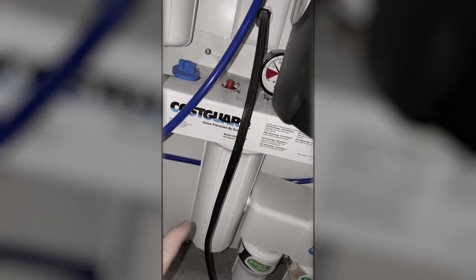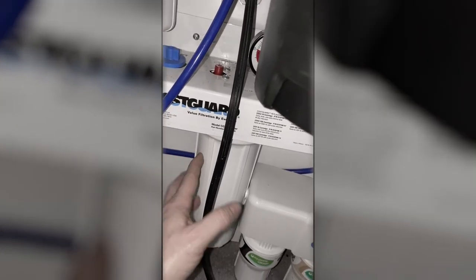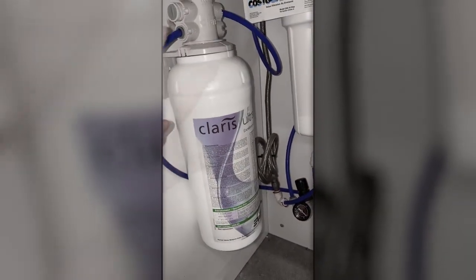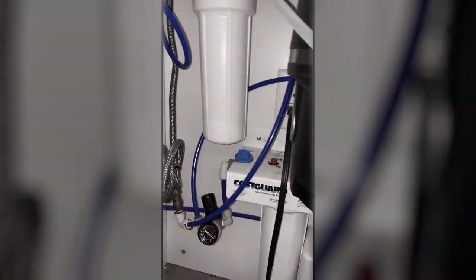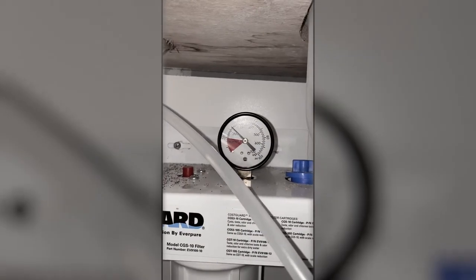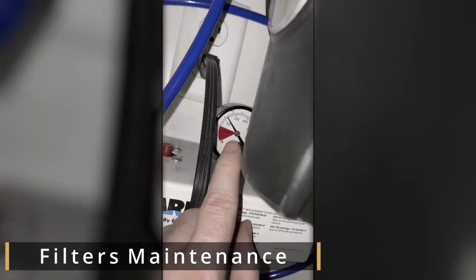This is the coarse grain filter. It operates at 10 microns. It comes out and into this unit here, which is the decalcifier. And then this goes into this last one here, which is a 1 micron filter. You'll notice that there is a valve here. It reads there at 33, and a valve here that reads at 32. We go from 42 to 33 to about 32.